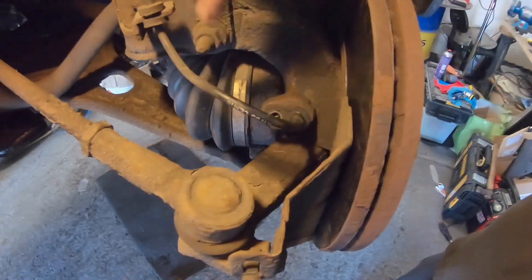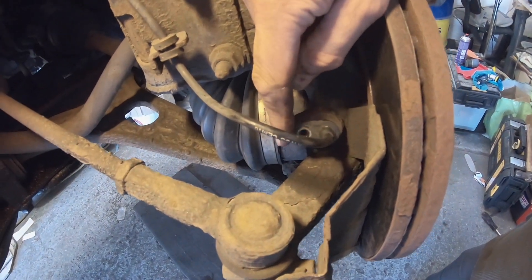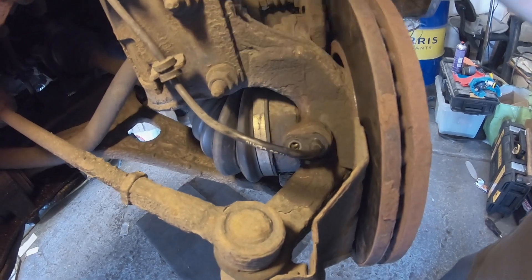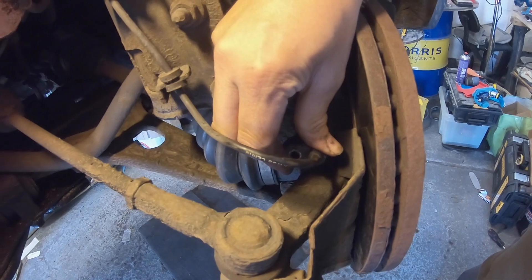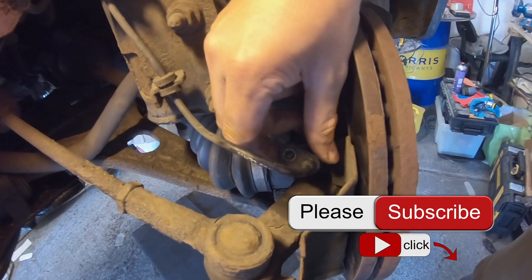An ABS sensor — just in case you're not sure what the ABS sensor looks like, I'll show you. We've already loosened it; I decided to start loosening it before I thought of doing a video on it. So down here, there's the ABS sensor. We have a hex bolt in there, so I've loosened that, sprayed a little bit of WD-40 just to loosen it, and by knocking it slowly down and then up, down and then up, it came free so we can remove the old sensor.